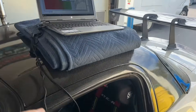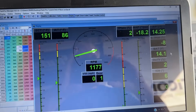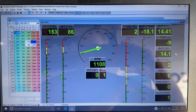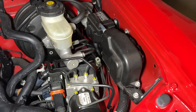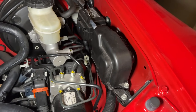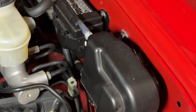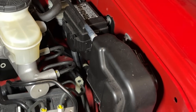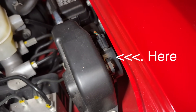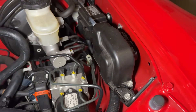We've got the laptop out trying to diagnose the idle issue. We'll double-check all the trims, but that seems to have made the difference — it's not over-revving anymore, it would rev up to two and three grand. On the '06 and up, it's kind of a retrofit that Honda did to make these drive-by-wire. This little box right here — this cable goes directly to your throttle body, and it has essentially a TPS built into it that sends a signal to control the throttle body.